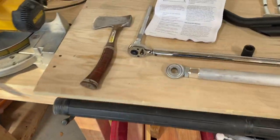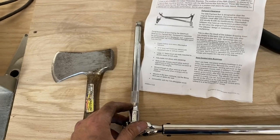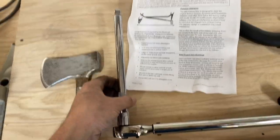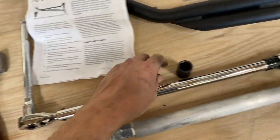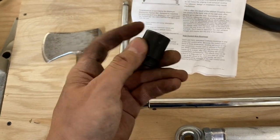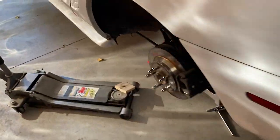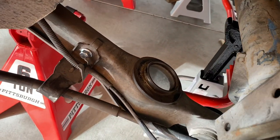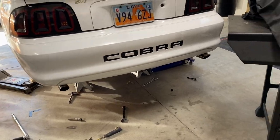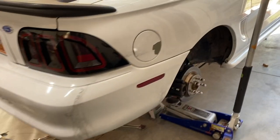I wound up having to use a really long extension. If you didn't have a sway bar, you could probably swing things out of the way easier, but because I have a sway bar and it's a Cobra, I had to use a long extension to get past the lower control arms and then use a 19-millimeter shallow or deep-well socket and torque it to 119 foot-pounds. I'm going to take this lower control arm bolt back out, jack that up into place, and don't put the springs in yet — get the bolt back in so it's in place. I think they want you to remove the passenger-side spring next, but mine's already removed.